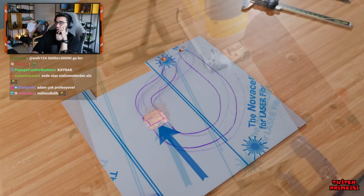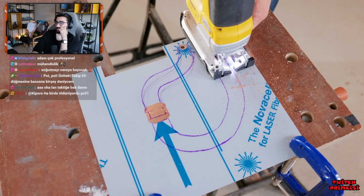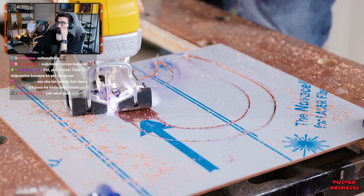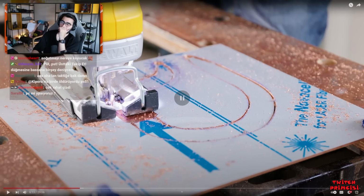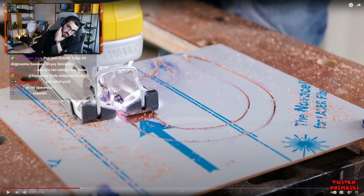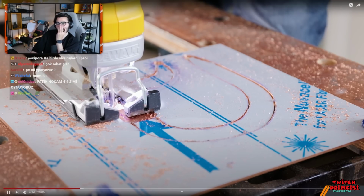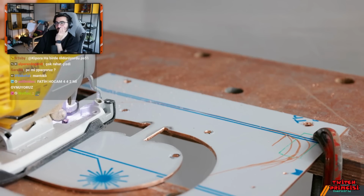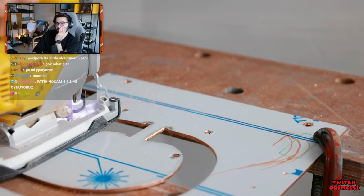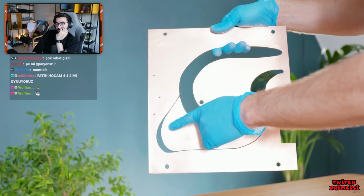Now, the reason why I'm utilising layers to make these channels is exemplified here, which is that it doesn't need any fancy equipment or CNC routers to make them. Just a good old jigsaw with a metal blade attached. I also need to make a much smaller channel adjacent to the larger one, which will be for cooling an additional component that I'll be tackling later.